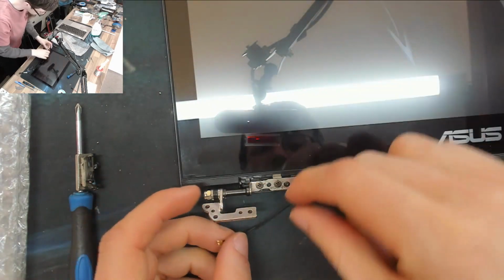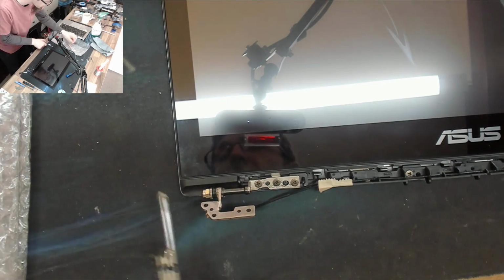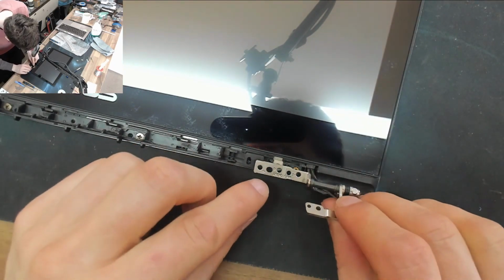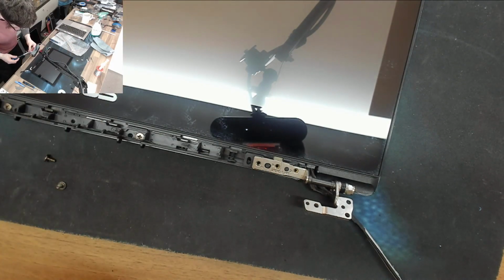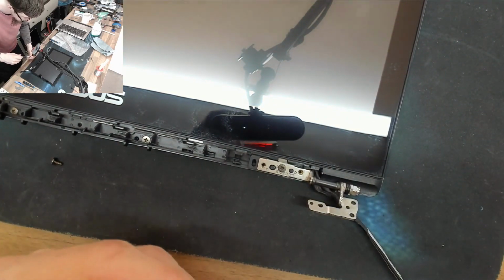And I'm just taking these screws up just into the bite point. So I'm not graunching them because you'll just snap plastic off, but I'm just making sure those are on properly. They ain't gonna come loose without a lot of work. And then really just time will tell how long this lasts, to be honest. I think we might be okay here. I think it'll be fine. Most likely what happened was that these screws worked themselves loose over time. And that's usually how hinges break. But again, the fact that this is such a common fault kind of indicates that the hinges are not properly designed in the first place.